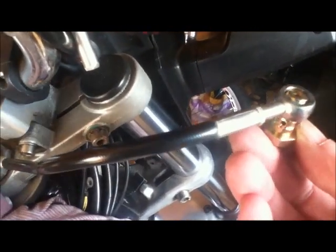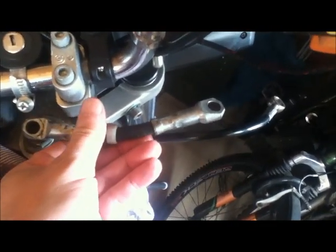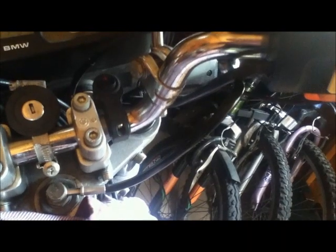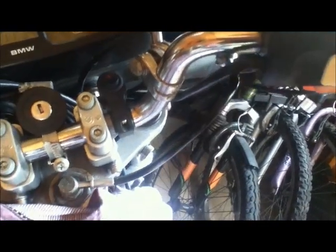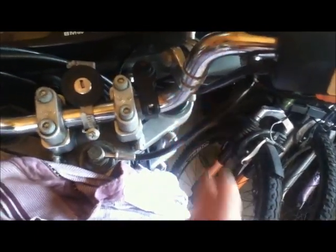I'm reconnecting the brake line with a new banjo bolt, copper washer on either side. The sharp-eyed will notice this isn't a standard hose — the standard hose came off because I've got handlebar risers and it no longer reaches. At some point when I renovate the bike I should put the original parts back on. The hose also looks a bit long, and that's because I can take these bars off, put drop bars on, turn it into a cafe racer, and I need the extra length for doing that.